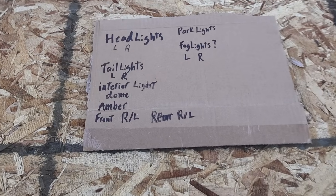It looks like we've got our consumers there. I think we're going to use some Deutsch Motorsport style connectors — they're pretty easy to use and they're nice and waterproof. Everything that's outside of the car, we'll do some of that shielding sheath stuff and then shrink tube the ends. On the inside, I think we're just going to do some interior Tessa tape. Let's check inside the garage and see where they got their measurements.